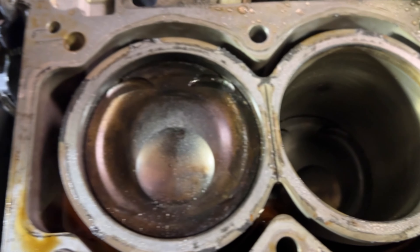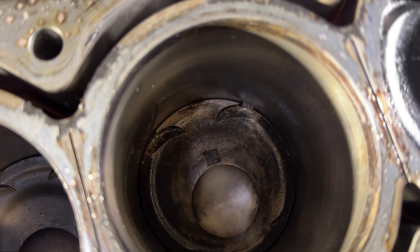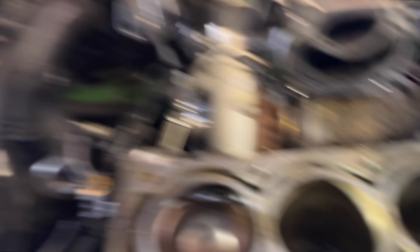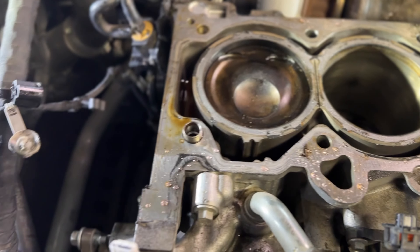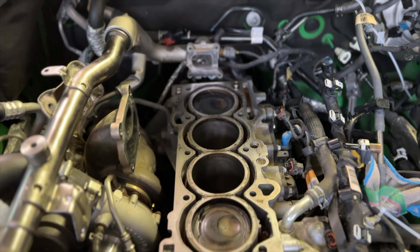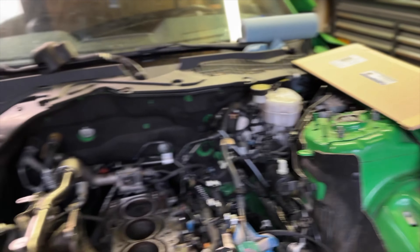We've got the head off. Looking down in here, the cylinders all look pretty normal for the most part. This one here is kind of clean, and I think that's because it wasn't firing right — it was taking in a little fluid. When we took the head off they were all flooded, but I believe the majority was just from us not draining the fluid beforehand. We're going to clean this up, get the new head gasket on, but we do need new studs, which Gabby's going to take care of — so this car will be here for a little bit.